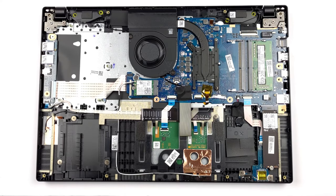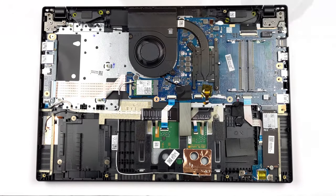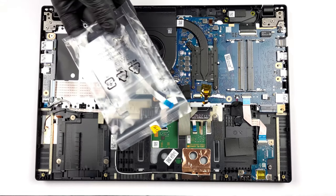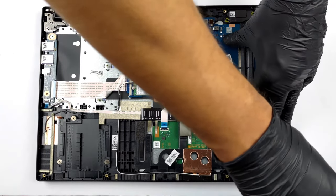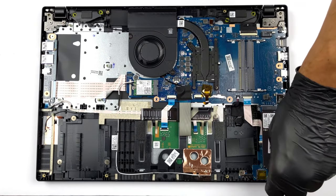Finally, let's take a look inside. The Travelmate P2 has two SODIMM slots for DDR4 memory, along with one M.2 slot and space for a 2.5-inch SATA SSD drive bay. In the box of the device, there are mounting accessories, so installing one isn't a huge issue. Our detailed teardown video shows how to access both the RAM and storage slots inside the laptop — we'll link it down below.